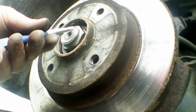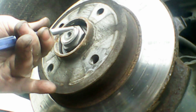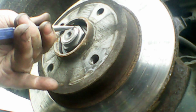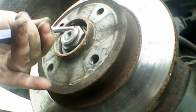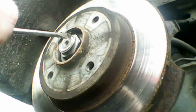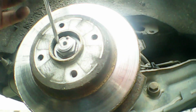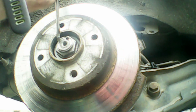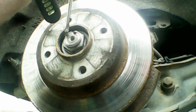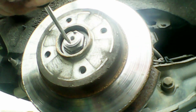We'll get a punch and knock up this stake so we can get the bolt off. This is the trickiest part — just getting it to come far enough up so you can remove the nut. I used a punch and a screwdriver to get it off nice and loose. Just keep tapping away and the metal will bend back out, then get a screwdriver in for a bit of extra leverage. Now we're going to do the other little stake — I don't quite know why this one is double-staked, normally they're only single staked.